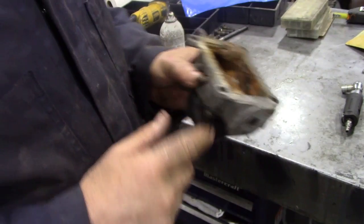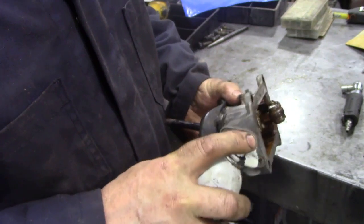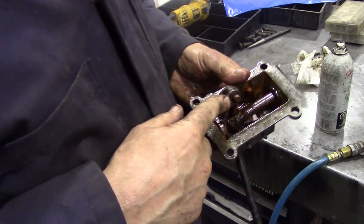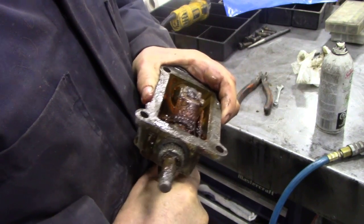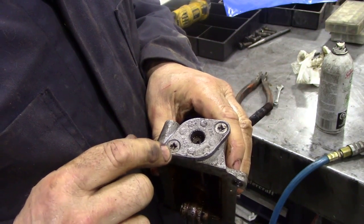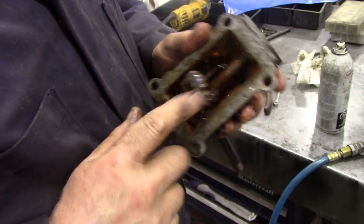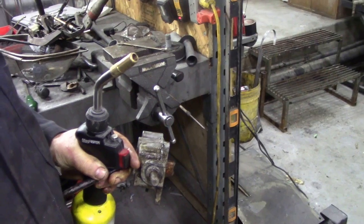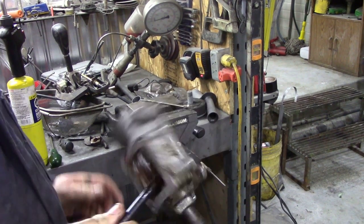What I'm going to do first is take off the cover, and whilst I'm doing that I'm going to spray it with Deep Creep, and hopefully that does something. Let's get those screws out. I've got a little split pin out of here and already the Deep Creep's working a bit - it won't pivot too much. I'm going to knock this pin out and then try and loosen these two screws. They're going to be tight so I might have to use a few tricks, but I'll tell you which one works rather than boring you going through hours and hours of trying things when you've got stubborn screws.